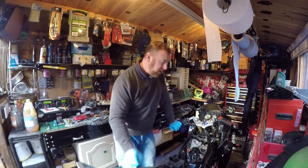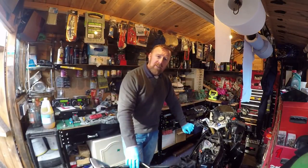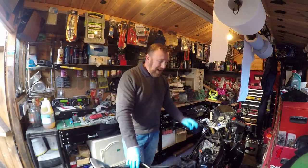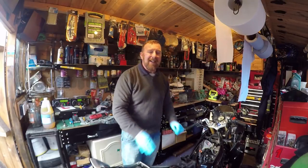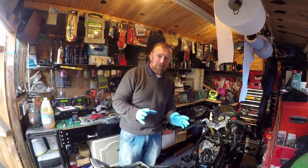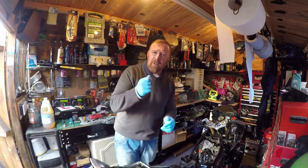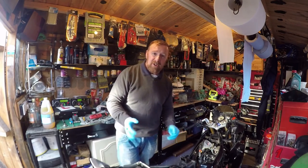9.5 turns out — I've got the side off still. Keep checking the plug. I had it running, start first time every time. Next morning wouldn't start. Every time I took the plug out it was absolutely black — soot black. Couldn't get any more description than just saying it was not nice. The plug is supposed to be a nice coffee-white colour. This wasn't. So I know it's running too rich.